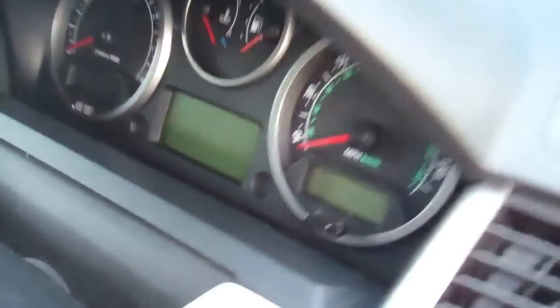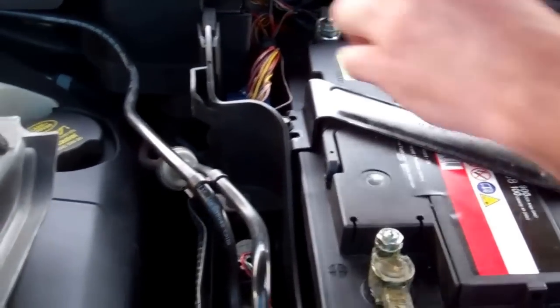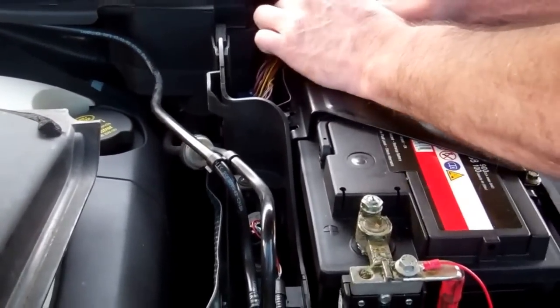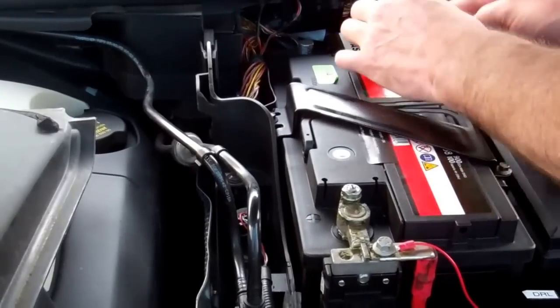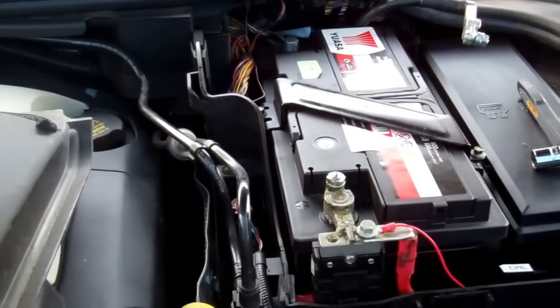So first thing we're going to do - we've got Tom Moundy who's made a start already. We're just going to disconnect the battery. When you're disconnecting the battery, disconnect the earth, remove the cover, and you want to tuck that out of the way somewhere so that hopefully the car won't be aware - be blissfully unaware - that we've disconnected the speedo and it won't flag up any errors.